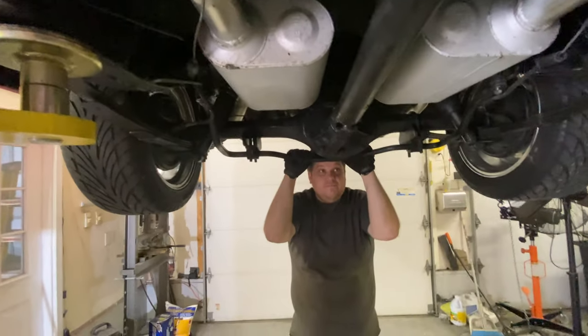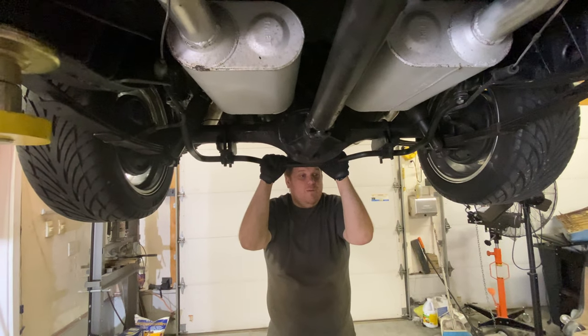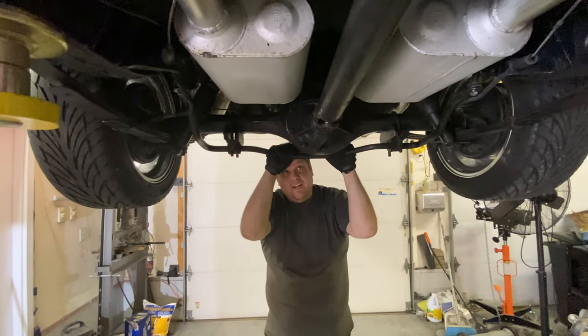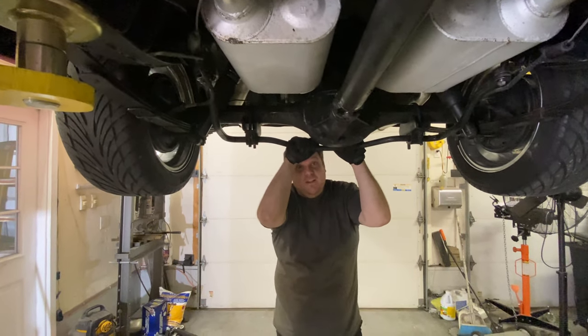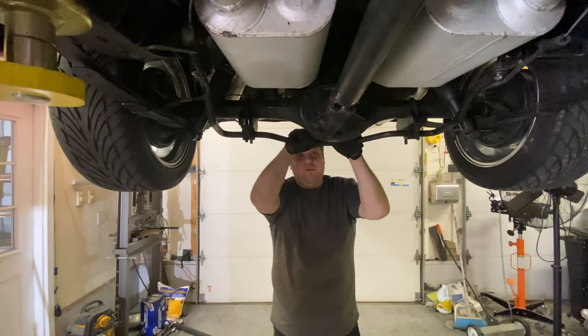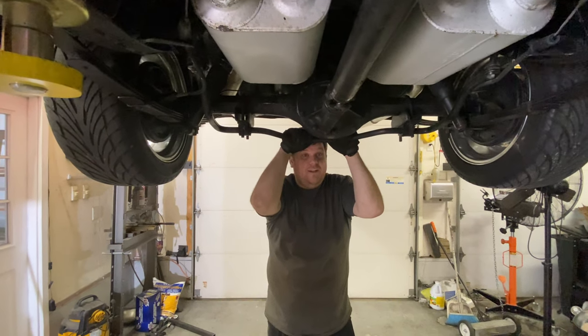All right, what's next? I guess we just start tearing down the front, pull the wheels and tires off? Not yet. I want to set it on the blocks and get a ride height. Get under it, and I want a pre-measurement of ride height and a pre-measurement of pinion angle, just so we know where it starts from. And probably get some left to right measurements and document it all really well, so that we have an idea of where we started ahead of time.